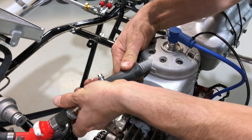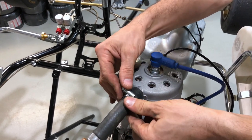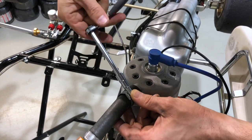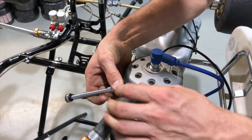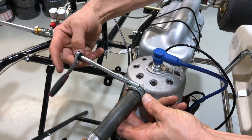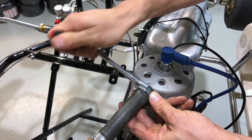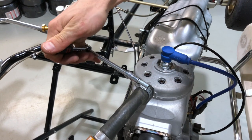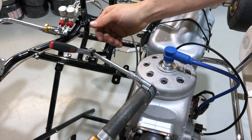We just need to stretch this piece of hose over the fitting on the combustion chamber. Put that on there, back this one off, then stretch that hose clamp out to get it over the bell end and apply a little bit of light finger pressure to get it started again. You don't want to over-tighten these because they're only a small steel pressing — if you keep cranking you'll end up stripping the thread out. Just firm pressure; you don't need a half-inch breaker bar on those little guys.